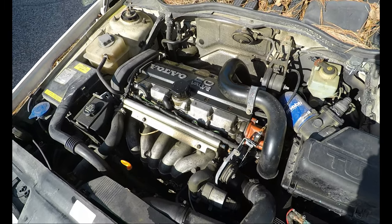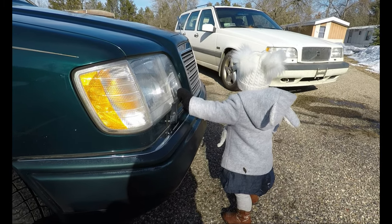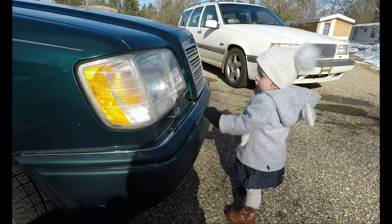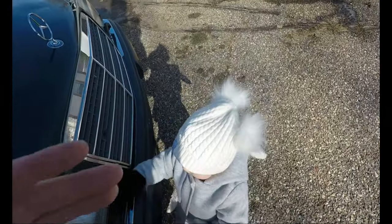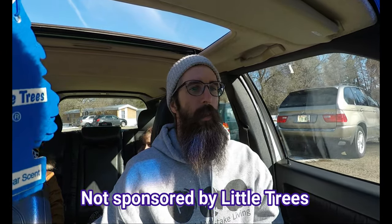Let's go take it for a ride. As you can see, my inspection services confirm this one does have headlight wipers and they will be broken off by the time I'm done. All right, here we go driving the station wagon — it goes into gear and we have three kids in here, so we're just going around the trailer park for now. There's something definitely wrong with the steering rack; it's real hard going straight. It gets into a certain spot and then it's easy-hard-easy-hard, so the rack might be bad.